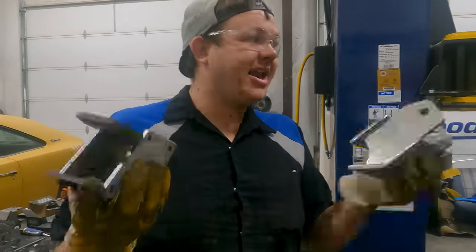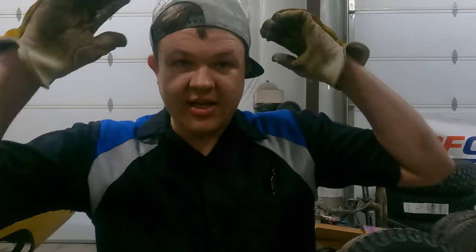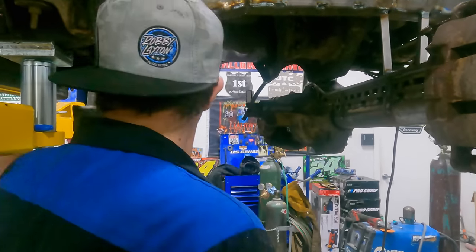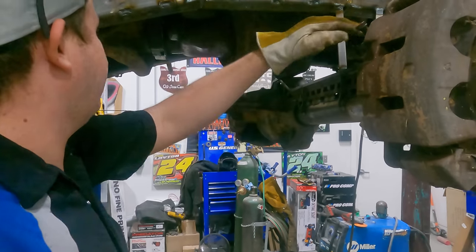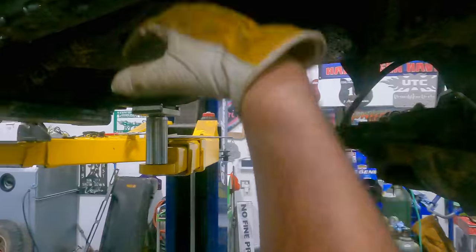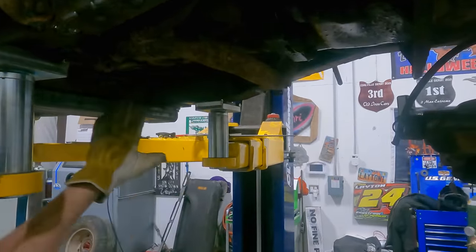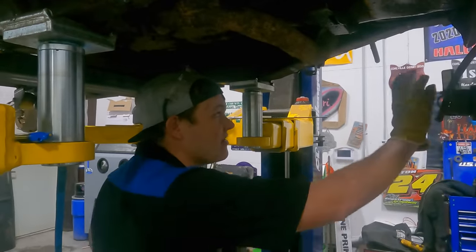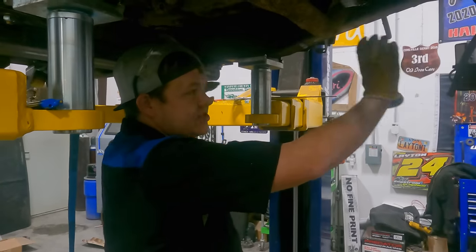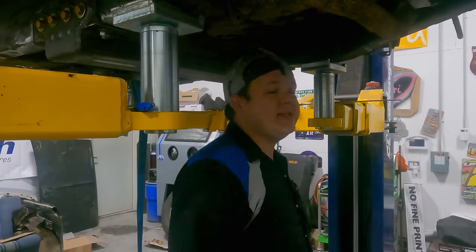This is the end result — now we've got to make them fit the axle. On the front end, we can't double-triangulate it like we did the rear because we just don't have the room. We're gonna triangulate it from here back to the bottom of the crossmember, and angle it in to the front of the crossmember so it'll miss the frame. The exhaust is gonna go — we'll cut that out. We should have clearance for the driveline. We're gonna four-link it right now and may end up having to modify it.